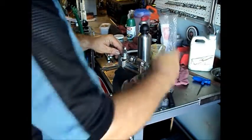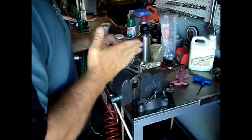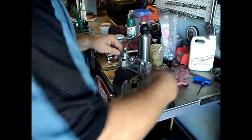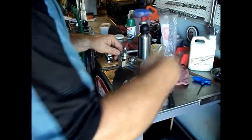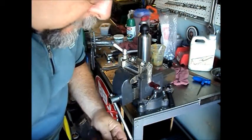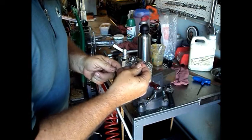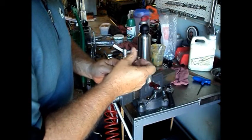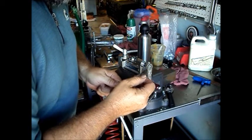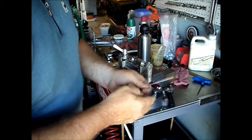So I'll roll the threads, keeping going until the rollers actually fall right out to the end of the shafts. After we roll that thread, we'll do a double check to make sure we're getting 10mm of threads. Then we'll do a test run with a nipple — should be able to thread it on with the fingers, right through until it comes through the slot, with no slop. It feels good. We're ready to do the other 35 spokes and then build the wheel.